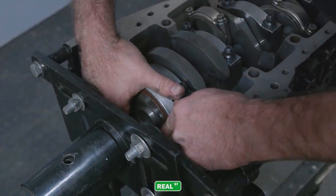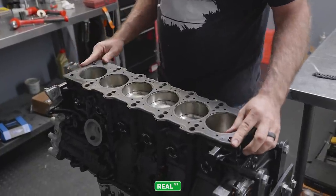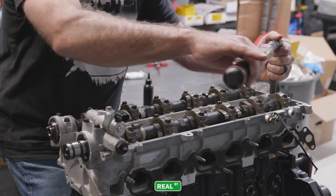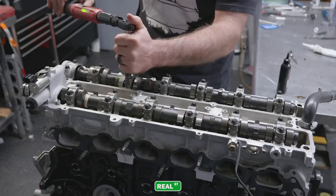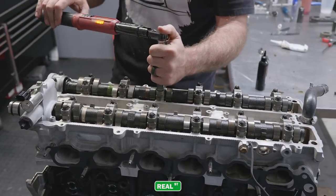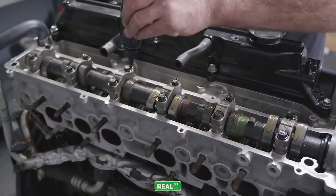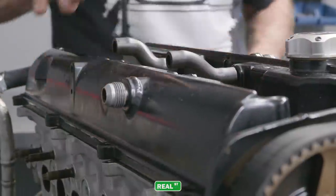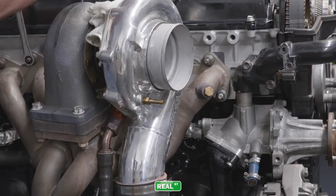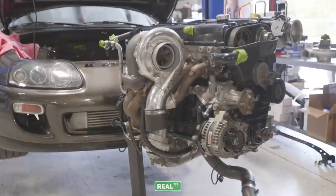After I install the remaining pistons and rods, I'll install the rear main seal housing, the oil pump, and the oil pan. Then I'm going to put the same Masworks CNC ported VVTI cylinder head back on the car with the same set of Brian Crower 276 cams I had before. So basically what I'll have is an increase of 10 millimeters of stroke, the same compression ratio, and a whopping 16.4 fewer pounds of things swinging around inside the engine. This should lead to an engine that accelerates well, makes good average power, and is easier on bearings. Let's get this engine buttoned up, back in the car, and hit the dyno.